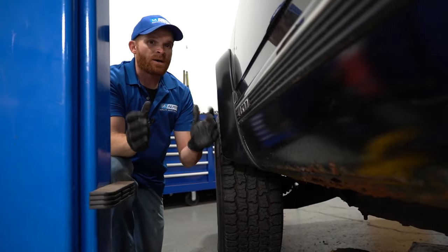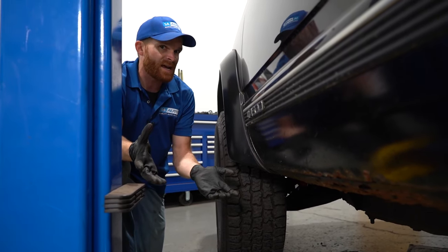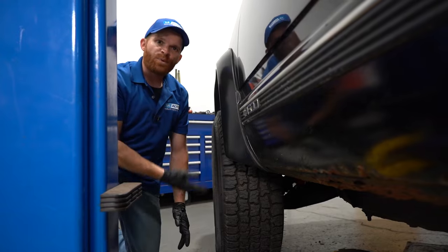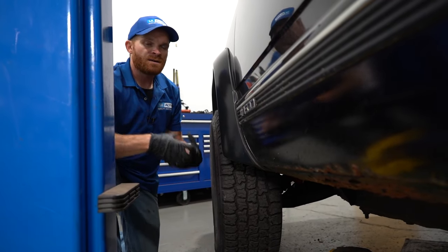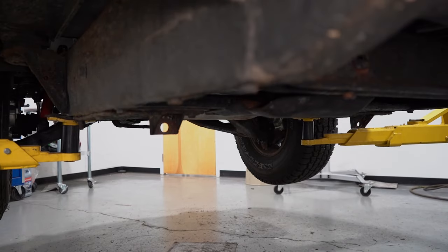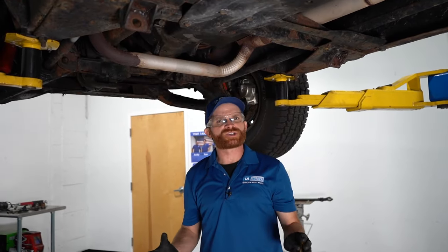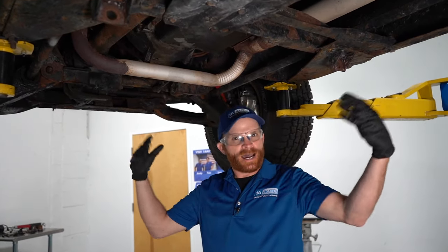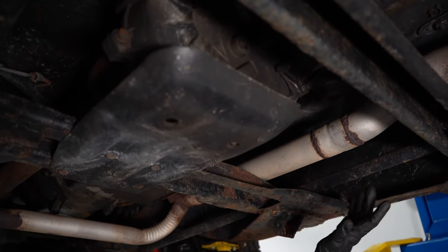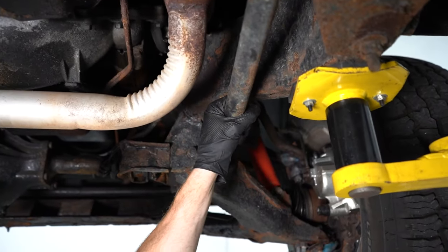Now that we've wrapped up talking about the rake of the vehicle, we're going to talk about how to make our adjustments with those torsion bars. I want to show you exactly what torsion bars are, but first I want to get the front wheels up off the ground so we can make our adjustments. I have a lift, so all four wheels are going to be leaving the ground. When you do this, make sure you do it from the frame so the suspension can hang. Your torsion bar is going to go from almost the center of your vehicle all the way up to your lower control arm.